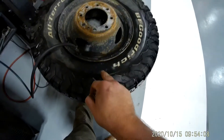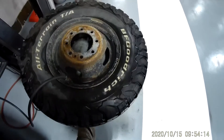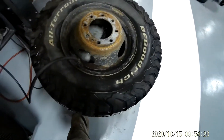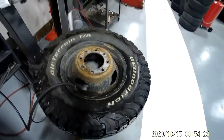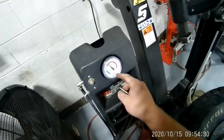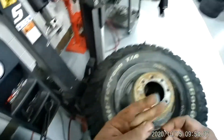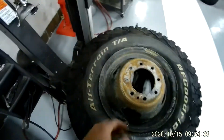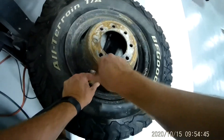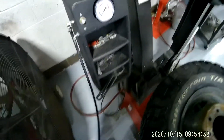Keep your hands clear from right there — it should make a popping noise usually. You don't want to go much more than 25 or 30 PSI. If it doesn't seat the bead by 25 or 30 PSI, you need to back up and do something different. The PSI gauge is on the inside — we're at about 35 and I think that bead is nice and set. So I'm going to put the valve core in using two hands, just twist it in — and it reads about 30 pounds of pressure.